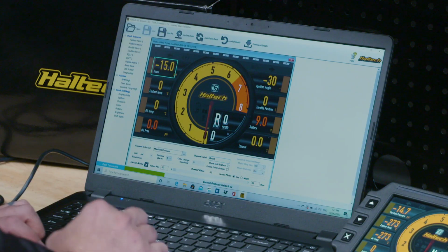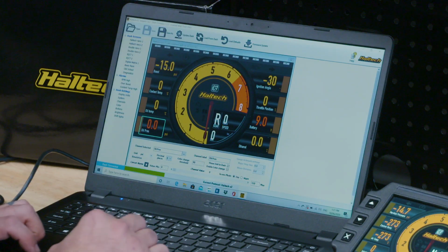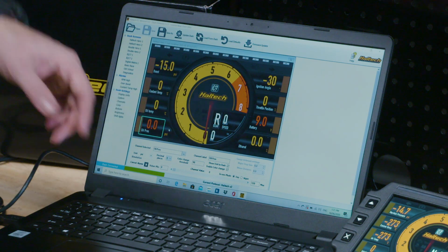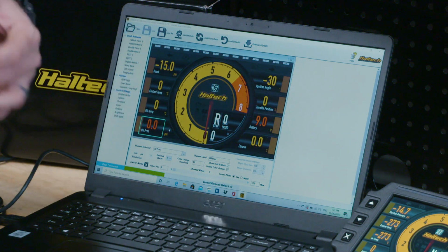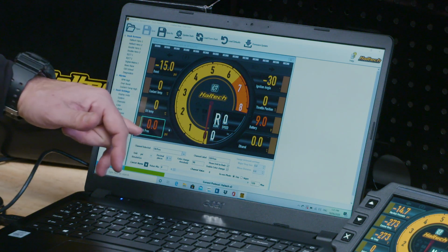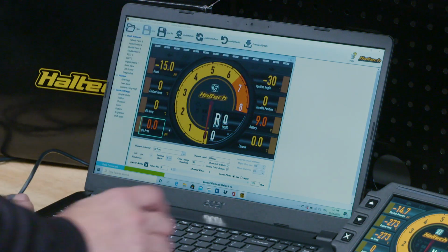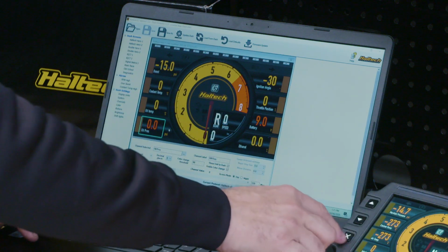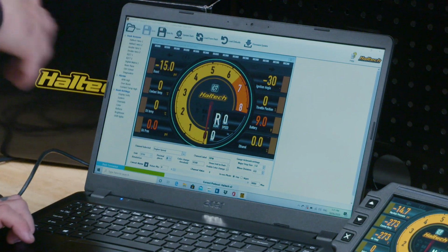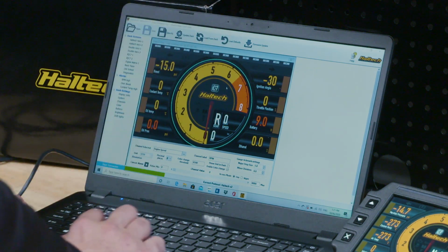The other thing you can start doing is also, if you have a look at this oil pressure one, it's got here selected that it enables a color change. So the color change threshold is just got to do with essentially a warning light. So if you've got things like battery voltage too low, or you've got oil pressure in the wrong spot, too low, too high, etc., whatever you've set up in your parameters, you basically can make it change color as well as have a warning light. Now if you get a warning light in one of these, this X button is actually to clear the warning, so it won't always hold it there. If you've got outside your parameters and backed it off, it can change.